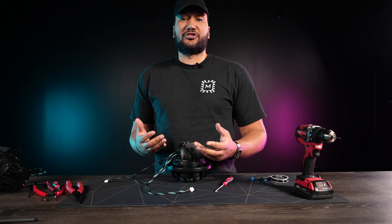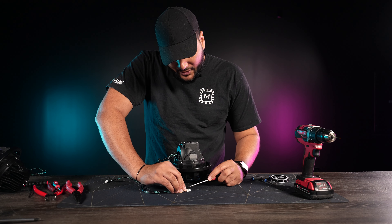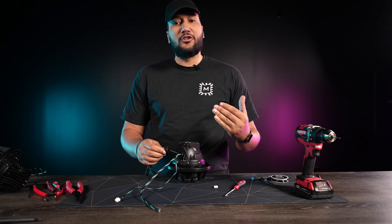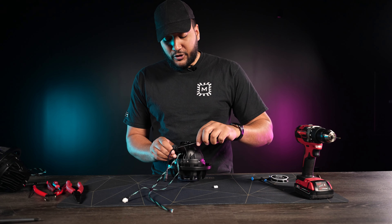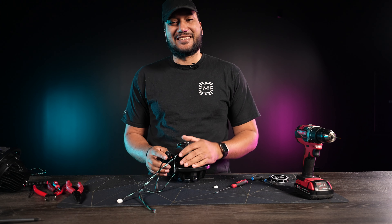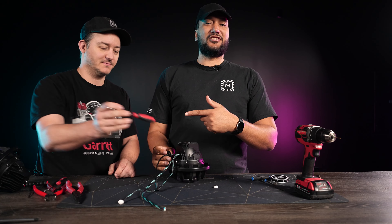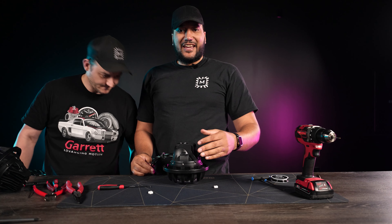To get this wire through the grommet and make it a lot easier on yourself, all you need to do is de-pin this plug. Go ahead and push down on all of these — apply pressure so the wire is actually coming out, then pull away and it's exposing all the pins. Take the pins you just exposed and push them all the way through the grommet so you can pull on this wire and make sure everything is weather tight. You can make this easier by having a friend take a pick, put it through, and start stretching it so you can get the wire through. This is Mike Jones — not the rapper, the mechanic — and he's going to help me stretch the grommet open to feed the wire through.